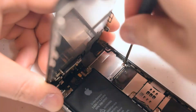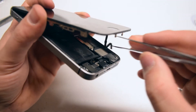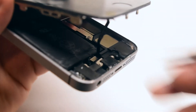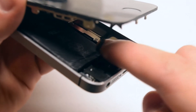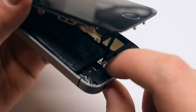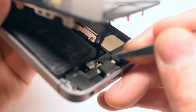Now the two Phillips head screws on the bottom. It's almost time to clamp up the phone, but before we do we'll need to make one final connection: the home button connection. Go ahead and align it with its socket first. Click it into place with your finger — this might be a bit tricky. Put some pressure on it with some tweezers and make sure it's firmly into its socket. With your finger, move the cable around to make sure the connection is good. Let's place back the shield over it — with the little metal part on the bottom, that's the correct orientation. Just place it over and click it in place. Move the cable around to make sure it's snug and won't come apart.